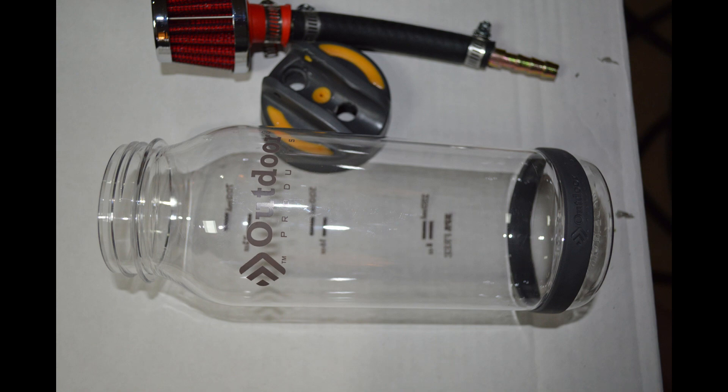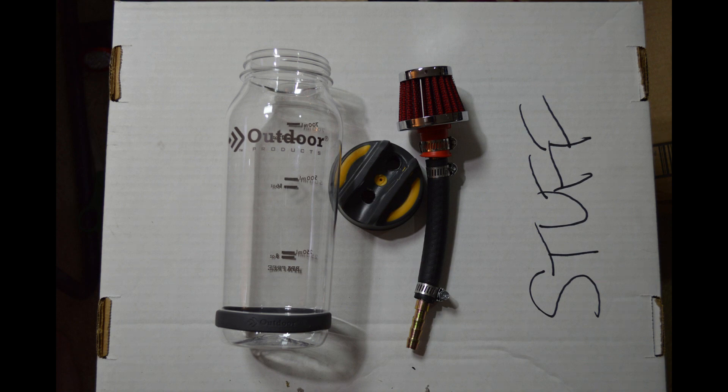Some people were using fuel filters from gasoline-powered tractors. I get that they do have a little bit of mesh in them, and that's better than nothing, but they're really designed for fuels, not for gases. Some people were reporting that they were seeing condensation, which would then run down directly through that vent line back into your axle — which is what you're trying to avoid. And if your axle never got warm enough to flash off that water, eventually you're going to start building condensate inside your axle, which is the opposite of what we're attempting to accomplish here.